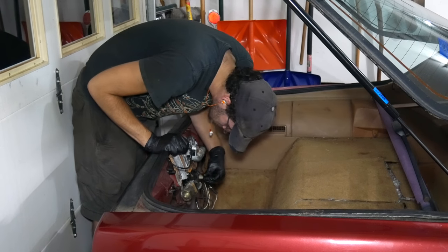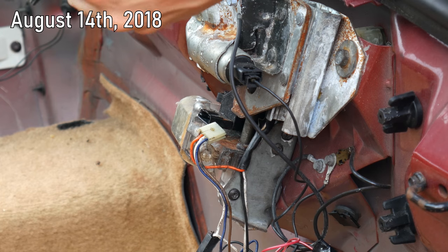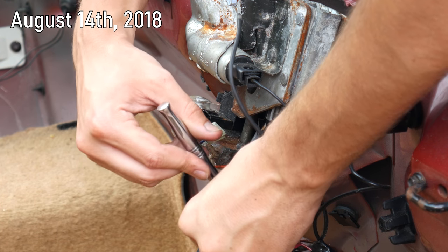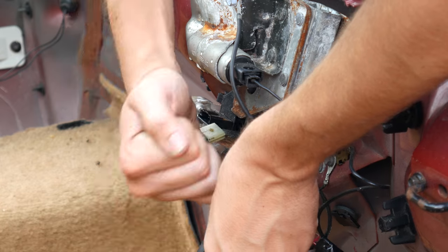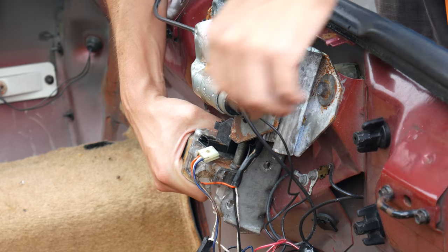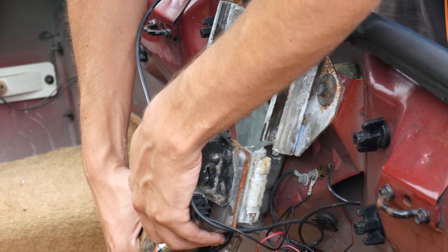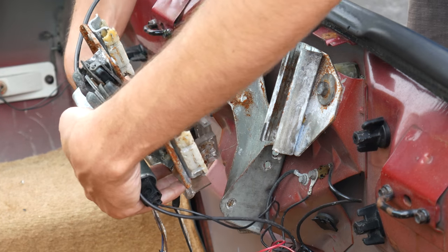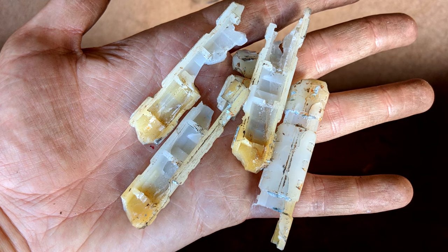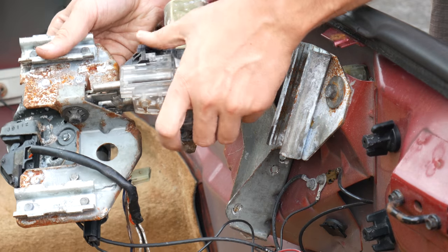It's tricky to do this leaning over the back and looking at everything upside down in a cramped space, so let's just remove the whole lift assembly. To do this we'll remove the motor connector again, then remove the three torx screws holding the plastic motor gearbox to the steel bracket. Once those screws have been removed the whole assembly is loose and we can slide it out of the bottom of the rails - and as we do, the remainders of those plastic guides fall right off. For now we'll set those aside since we're worrying about the electrical component first.